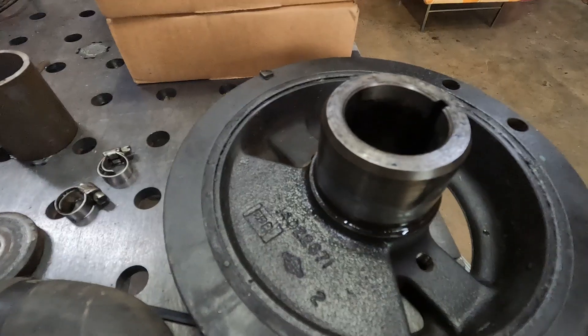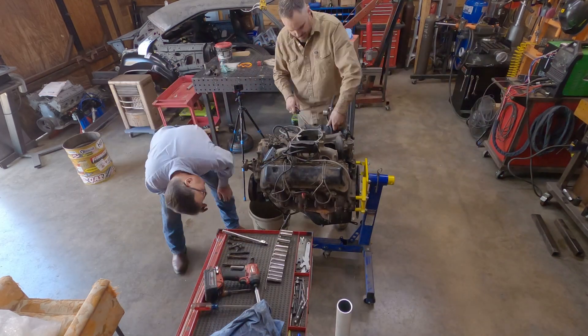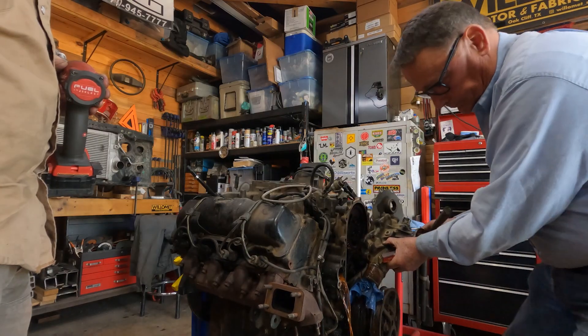Anyway, my engine had thrown — what we figured out was that the harmonic balancer, which sits on the front of the engine, had at some point worn out. The little rubber ring was probably desiccated or something like that. When that happens, it puts a load on the crankshaft, and because these crankshafts from the factory way back in the 80s were cast, they're really not all that strong. They can't handle too much of a load. Power is one thing — a wobbly load on the end of a crankshaft is enough to break it. We'll get into why that happened and what we're going to build next to replace it. But before we convene the future planning committee, let's take a deep look into the carnage that's hiding inside the 6.2. It's a lot.